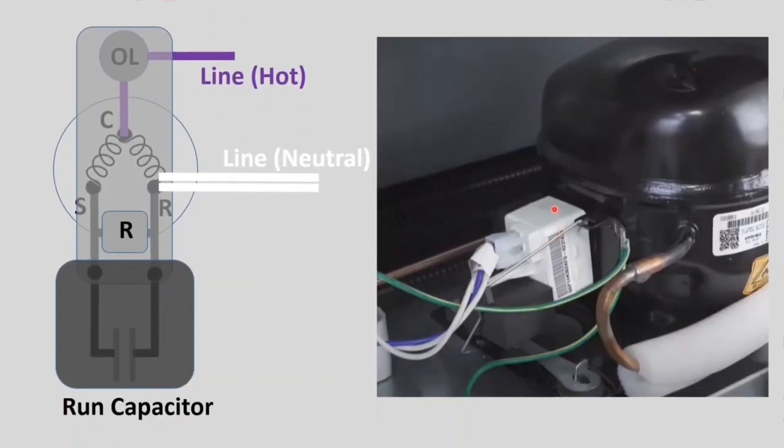In this case we have the relay and overload in one box, and the capacitor is this black box plugged in on top of the relay. This purple wire is one line that goes to your overload and relay, and then you have a pair of white wires that go to the neutral and to your relay, and the run capacitor is just plugged in. In this case you need to remove the white box and not use it anymore, but keep the capacitor — that's your run capacitor. Use those connectors and go back to the same setup as the last example.